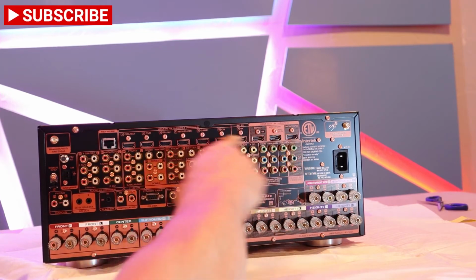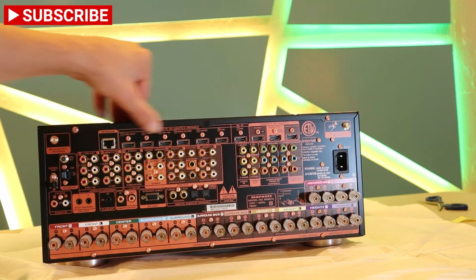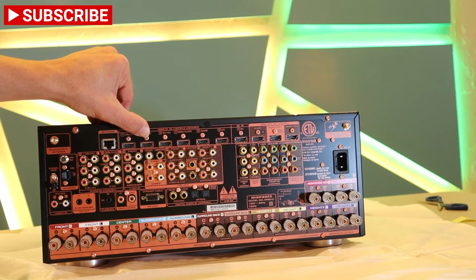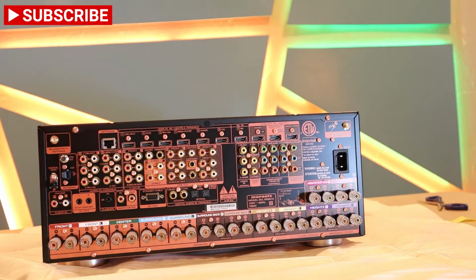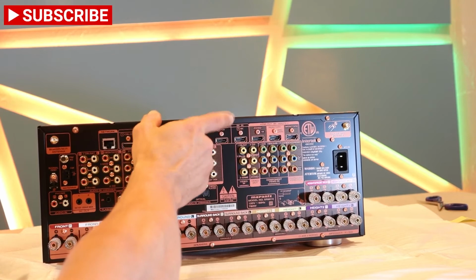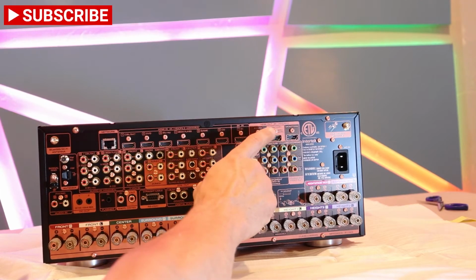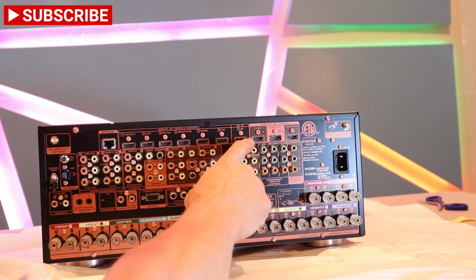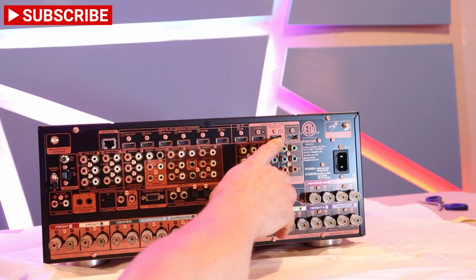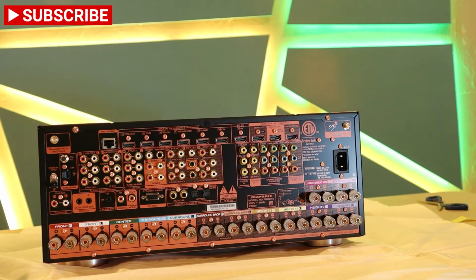As you look on the back of this unit, you've got your 1, 2, 3, 4, 5, 6 regular HDMI inputs. This does support the latest HDCP 2.3. All these are assignable. And then your 7th input is your dedicated 8K in. This also gives you 3 outputs with a dedicated 4K output for zone 2, and then mirroring outputs with eARC on the main. So super cool. The 8K is upscaling on all inputs. The 8K is at 60 Hertz or 4K for 120 Hertz pass through.